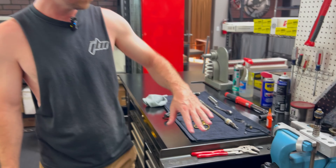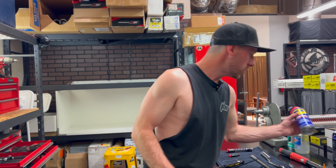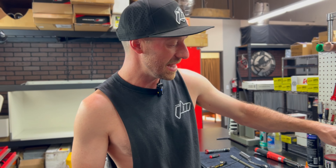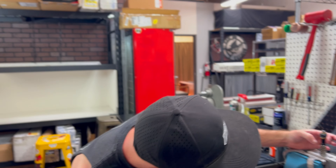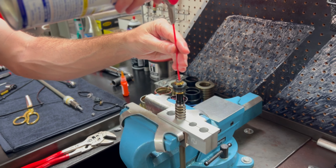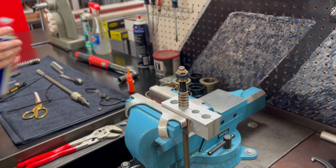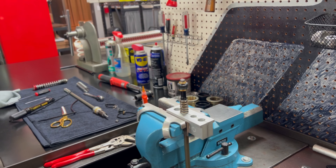This torque spec is pretty low, which is why we use Loctite, and also why you're going to wait at least six hours or more to let this Loctite fully cure before you reassemble it into your forks. We're also going to use our WD-40 method again to ensure no Loctite went down into the center. This is going to squirt out at some holes at the bottom, so make sure not to squirt yourself.